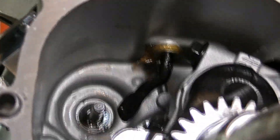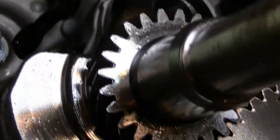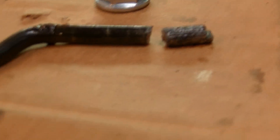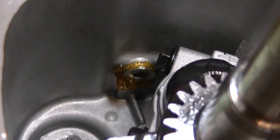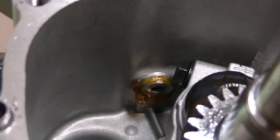Now we just need to remove this little paddle piece that slides in and out. We've got that governor removed — I just took a Dremel and cut the top off with a little cutting disc. Now we need to tap that hole right up there. I believe it's a quarter-inch bolt, so we need to get a bolt and our tap set, tap that and plug it up.